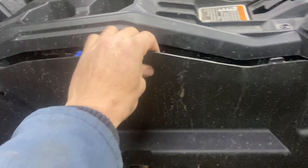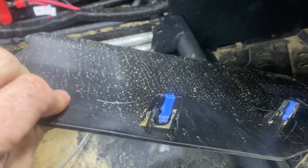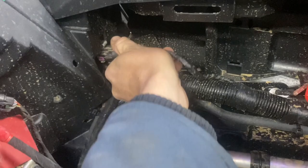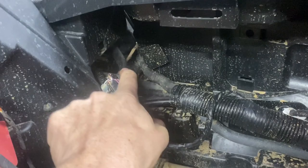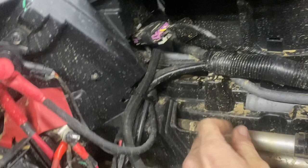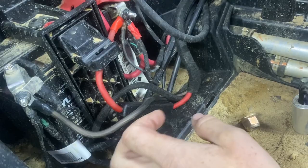To get these side covers off, just pry it apart and pull — they're on little push pin clips and it slides up and out of the way. To put it back it's the opposite; these little blue clips will pop off and get stuck, just slide them back on — that's what locks into these little holes. You can tug the wire all the way through, have someone feed it from the back side through to you, feed it down, and organize it within the factory wires. There's a zip tie right here — cut it, put the wire there, and re-zip tie it so it holds nice and snug.